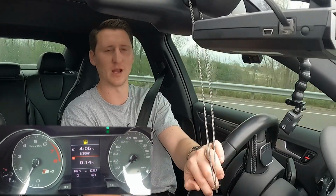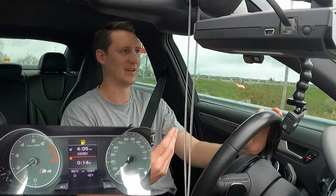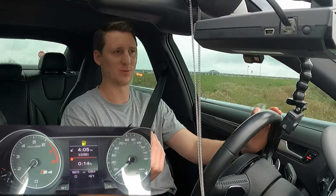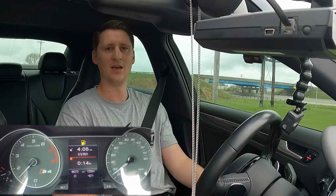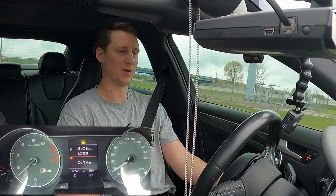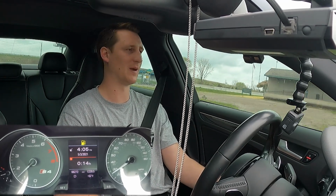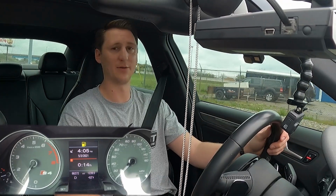So now when we get to the shop here, we're actually going to check the transmission fluid level just to verify. We got to make sure fluid's proper, because this thing is acting like, hey, it could be low on fluid, and that's why it's not engaging and disengaging correctly. So other than that, my thoughts are right now, mech unit all day. We have a brand new mech unit sitting at the shop right now, so let's go check the fluid level and get ready to do a mech unit.